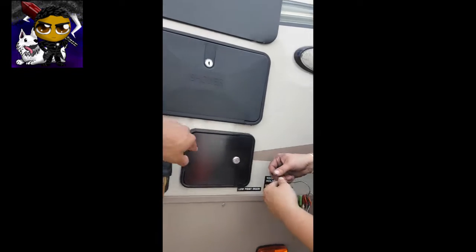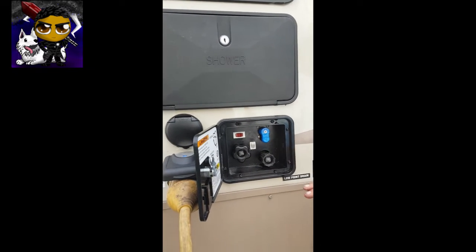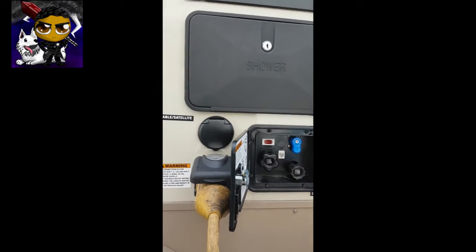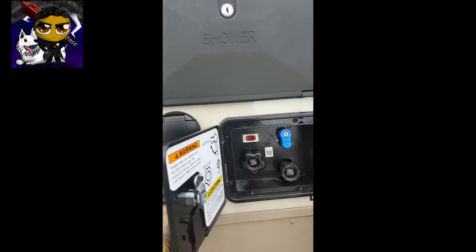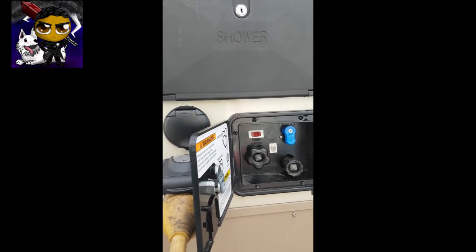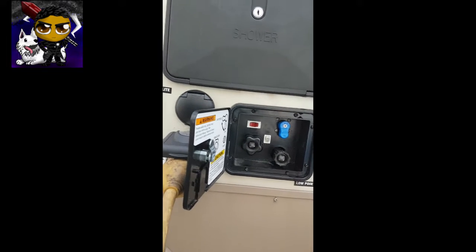And then this is just, I'm assuming the levers for the... Nope. This is going to be your water hookup. Oh, okay. Okay, so your black tank inside has like some nozzles on the inside of your tank to kind of rinse it out, because they like to build up debris and whatnot, and that hinders the monitor panel from reading your levels. So they have this tank flush here. So that way you can hook up like a regular garden hose to that, and you can flush your tank out. That way it kind of cleans it out for you. Gotcha. If you do use that, you want to make sure that these are pulled open. Because otherwise, too much pressure on the pipes can rupture your pipes or potentially blow your toilet off the floor.